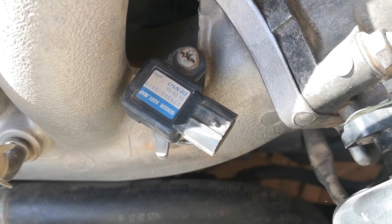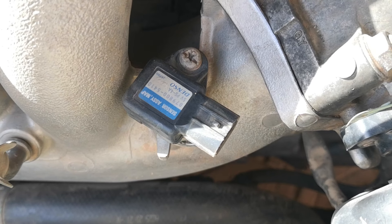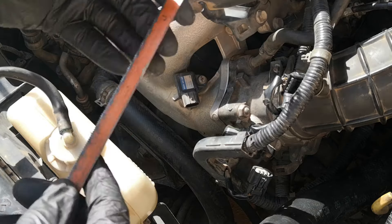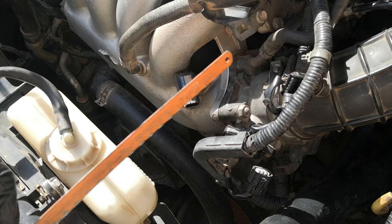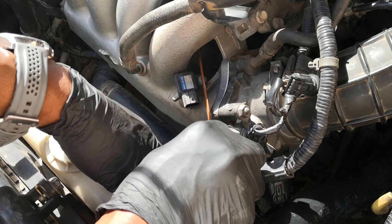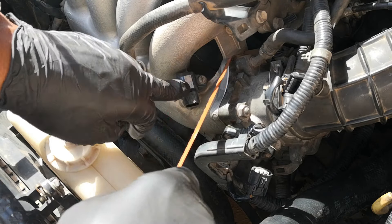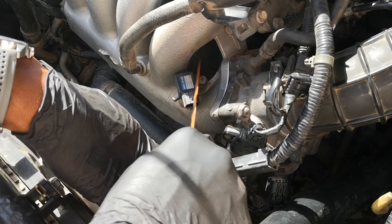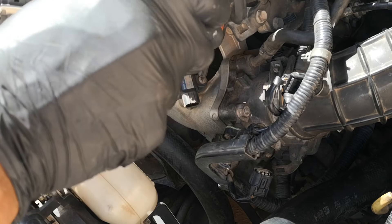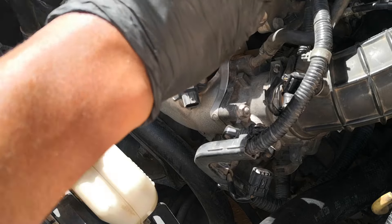If you look closely, you would notice that the head of this screw is stripped out. I don't really know why Honda decided to use a screw here instead of a bolt. It's a Phillips screw normally, but that's stripped out. The trick is to use the blade of a hacksaw and go in — basically convert it so that a flat tip screwdriver can take it off. I already did this about two or three years ago, the last time I did this. So with my flat tip screwdriver, give it a little knock, and it breaks free.